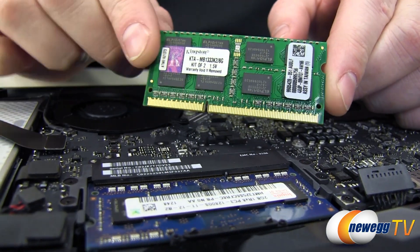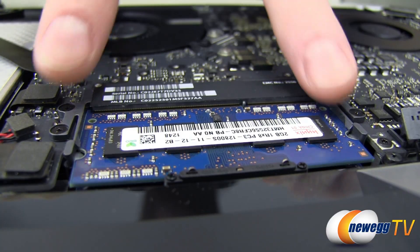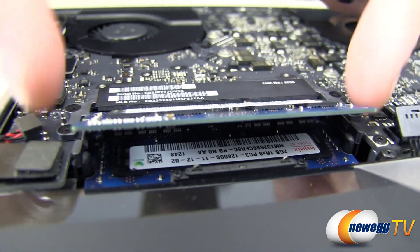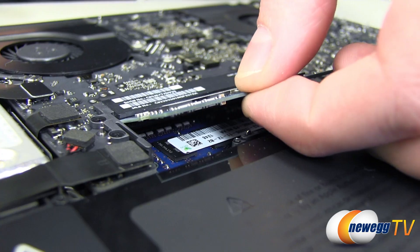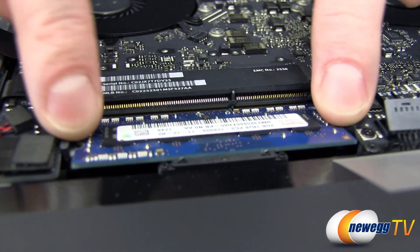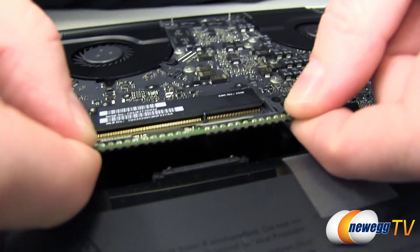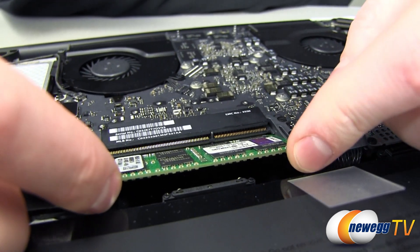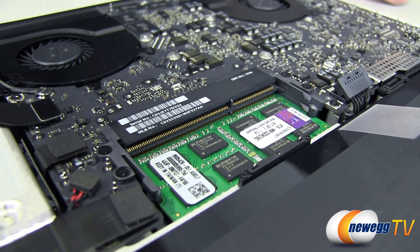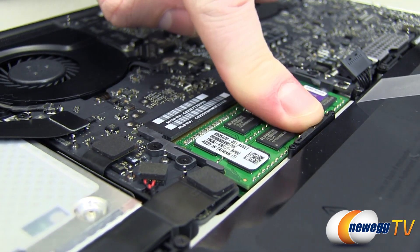While we've got the back plate for the laptop open, we'll go ahead and replace the system memory. This is actually a fairly simple process. Just pull the plastic latches away from each side of the SO-DIMM on the memory that's already installed — you'll see the memory pop up and you can simply pull it out. Repeat that same method for the second DIMM below it, then insert your new DIMMs at the same angle. Push them down until they bottom out, then push down until they pop securely into place and the latches snap on top.